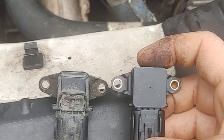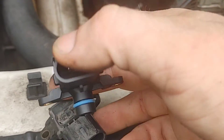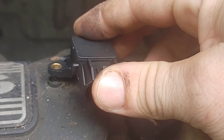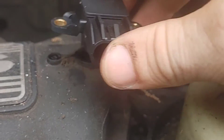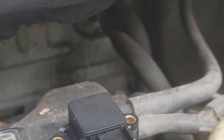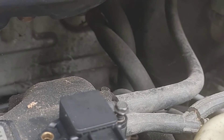As you can see, that o-ring is flattened out and we're missing a little plastic panel piece on the top of that sensor. I'm going to use my finger and move the dust away from the hole — I don't want to push the dirt into the hole itself. Just move it out like a starburst, working from the center of the hole outward, so that when you put this new MAP sensor on it's going to go in there nice and snug. What you're going to do is take it to the four o'clock position and wiggle it in.